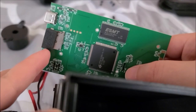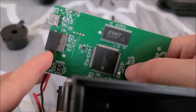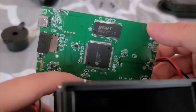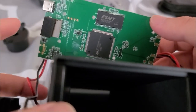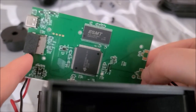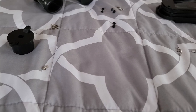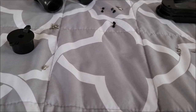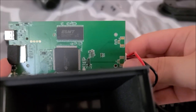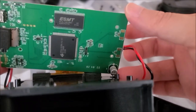Yeah, this guy does have a real-time clock, because you can actually timestamp everything. So that's got to be a 32 kilohertz crystal for the RTC, probably built into the chip. There is the main crystal right in there for the chip. And more connectors on this side that aren't populated. Let's see if I can get a close-up. One says LS1. So I guess like loudspeaker? I don't know. The other one's MK1. Yeah, this guy is the LS1 and this is the MK1. Got a big old surface mount cap in the corner there.